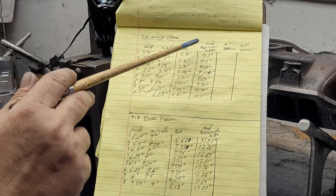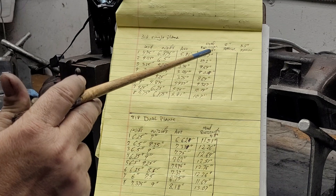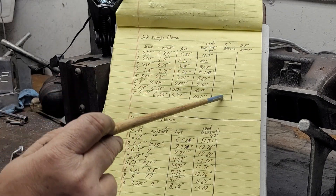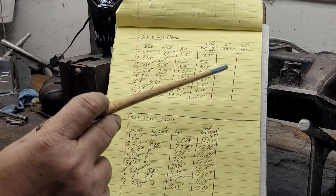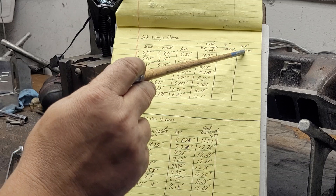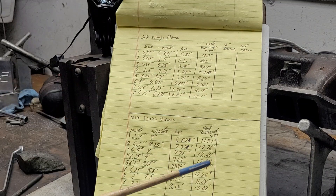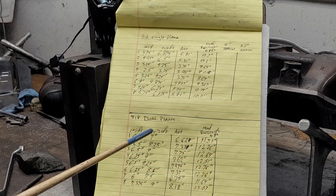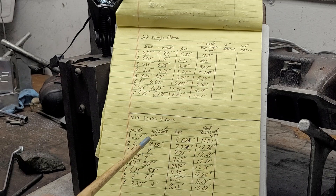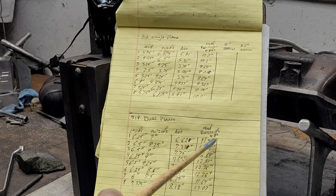All of these can be calculated for the Helmholtz resonance — I didn't do that today, I have a bunch of other things to get done. If you guys want to take these numbers and give me the RPM for them, that'd be great. I was going to include the spacer, but in reality once you get into the plenum it's not really runner length anymore, so I'm not going to use that. Same deal with the dual plane — inside, outside, average it, add it to 4.89.